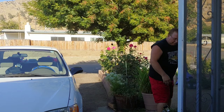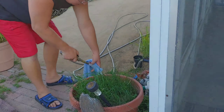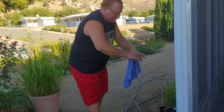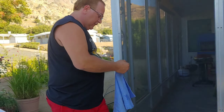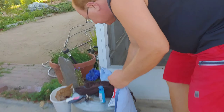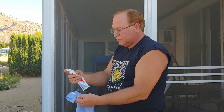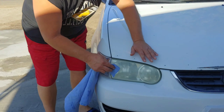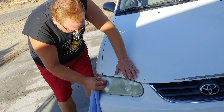The bug spray re-molecularizes all the plastics on there after you're finished. I'll show you how you do it. Get a little piece of a chamois rag, wet it. Get a little bit wet on there, squeeze it out a little bit. Then put some toothpaste on it.